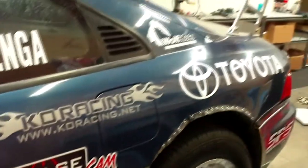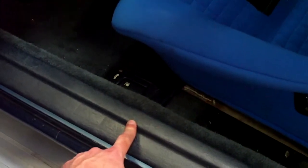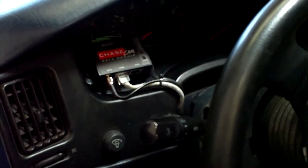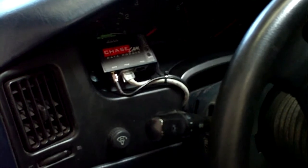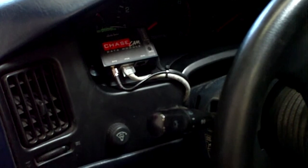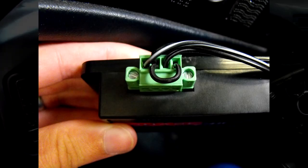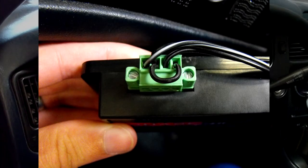Similarly, we've tapped into the vehicle RPM signal on this car. Because it's a mid-engine car, the RPM signal runs along the driver's side door sill from the engine up to the dash. We've pulled this panel and tapped into the RPM signal, sending that signal to the plus on the RPM port on the data module. We've taken the ground for the RPM and run it from the ground of the throttle position sensor right to the ground for the RPM — a small cable going between the minus on the RPM and the minus on the sensor input on the data module.